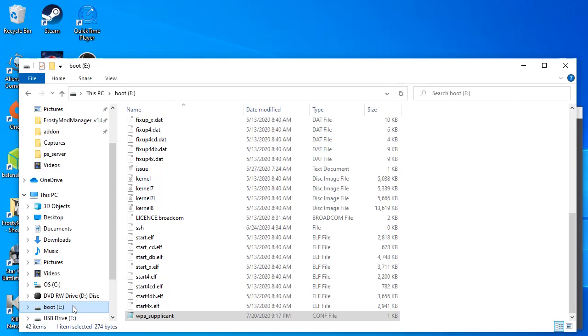Once it gets started on your Raspberry Pi, you will see a new Wi-Fi network created called PicoBrew in all caps. And then on your Pico device, you will need to select that network, PicoBrew, and the password is all caps PicoBrew, and that will join your Pico device to your Raspberry Pi offline server.